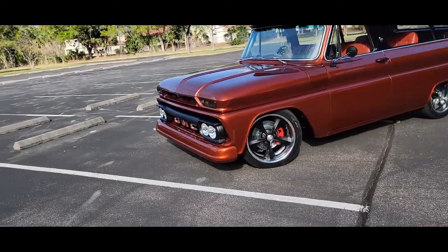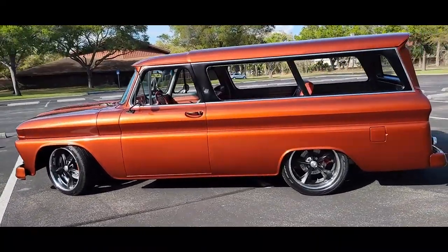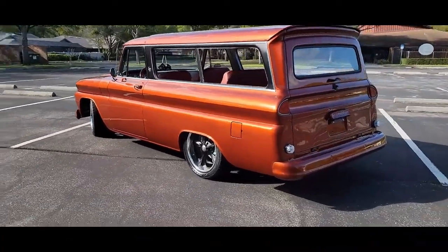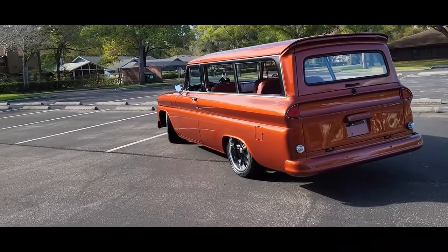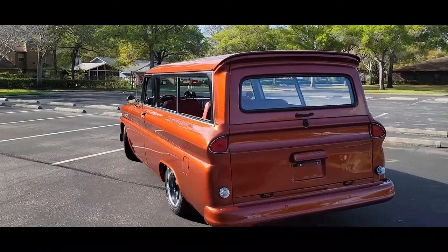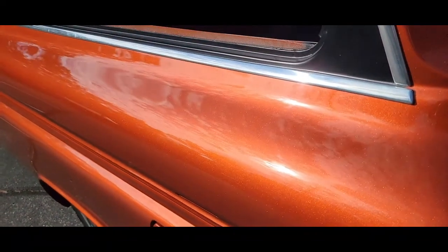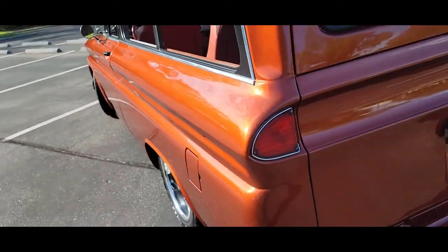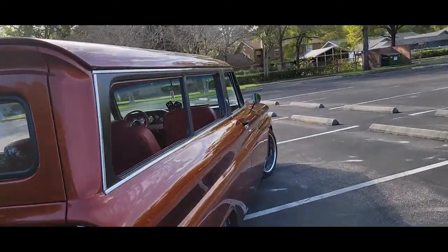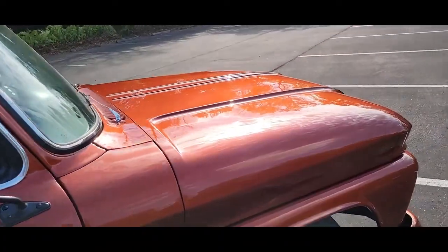One more walk around. For all you people that want to paint, there is a difference between your expensive paint and your cheap paint. $1,300 a gallon. I probably got $2,500 to $3,000 just in base coat on this. So there is a difference. The more expensive the paint. This is PPG Deltron, and I use Deltron and Omni Plus. Omni Plus does not have all the toners, the correct toners. It'll be close, but you won't get the correct pearls.